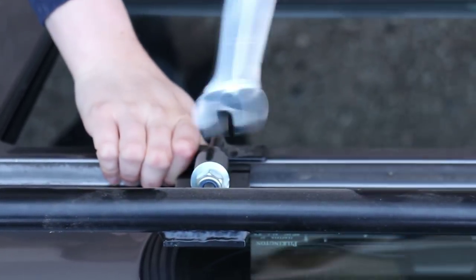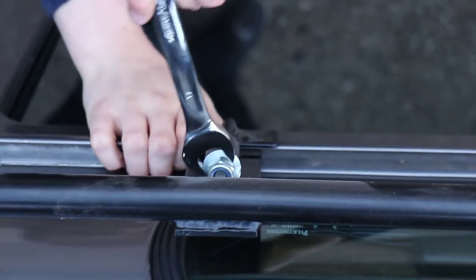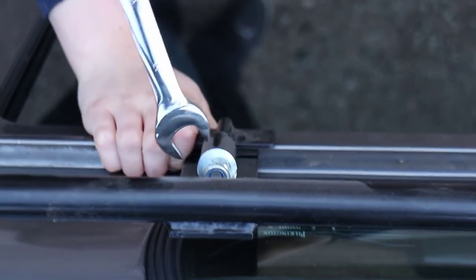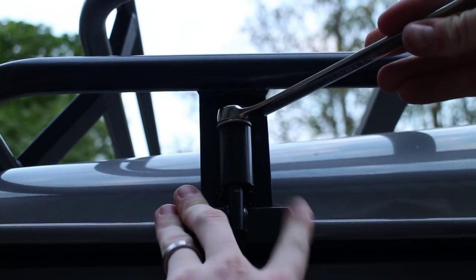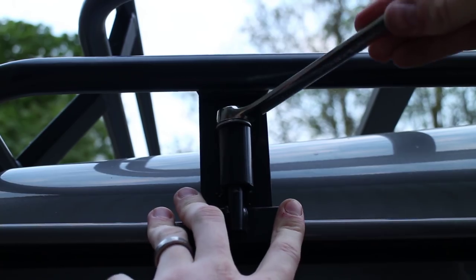We're working around tightening the nuts gradually — we'll take 2 or 3 passes to do this till each nut is fully tightened. You'll notice that as you do it the opposite nut slackens off, so that's why this is the best method to secure the roof rack.